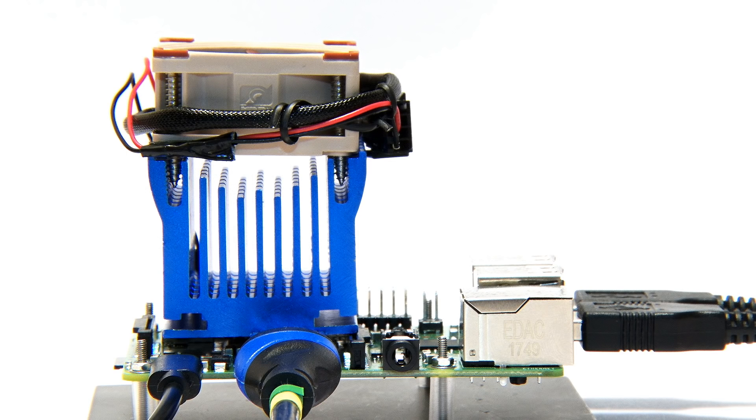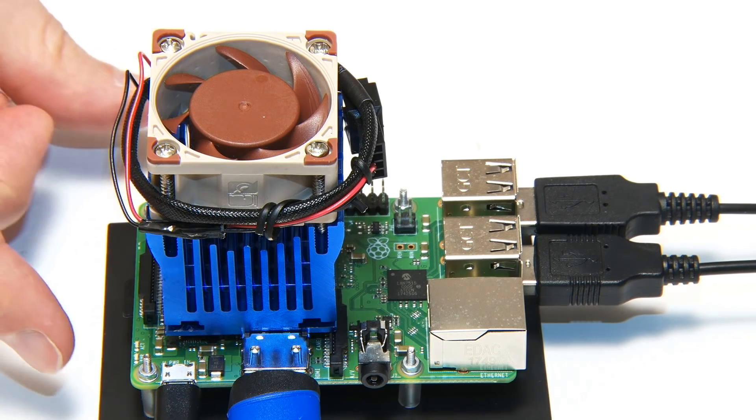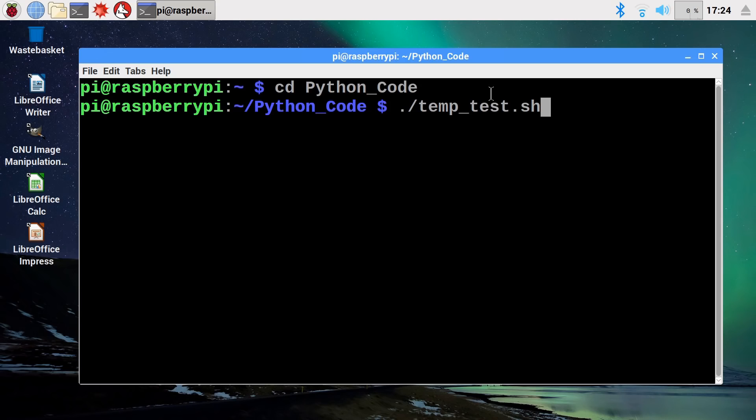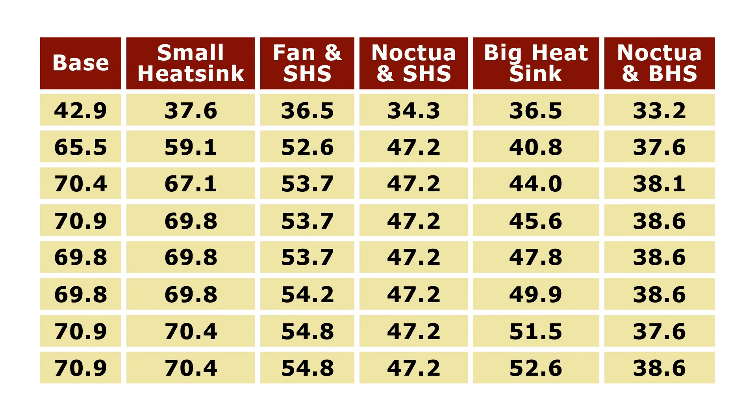Here I am with the final cooling solution. I put the fan on top of the heatsink, which screws in very easily. This design is not very well secured onto the Pi — it's only held on by the thermal compound for now — but it will work. The fan has come to life. By moving from the small heatsink with a large fan to a large heatsink with a large fan, we've knocked about 9 or 10 degrees off the temperature of the Pi. It's clearly stabilised around 38.6 degrees, proving that the Noctua fan with a large heatsink gives the best result.